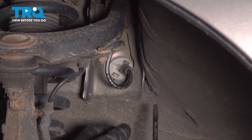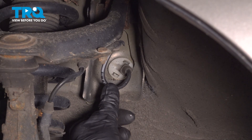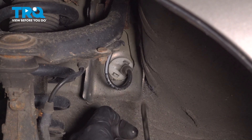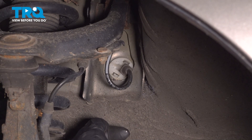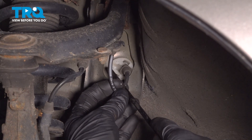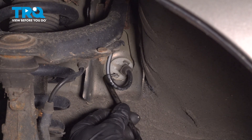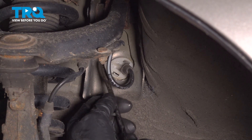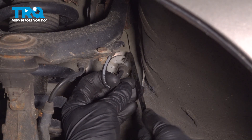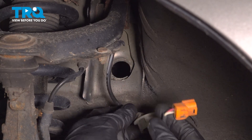You can use a small pick. Looking at this plastic area, you'll find that you have two locking tabs — one down along the bottom and one just up above it. You want to squeeze those tabs towards the center and then gently pry this out. You can use a pick or even a screwdriver, whatever works best for you. Pull that right out of there.